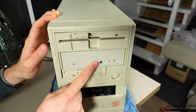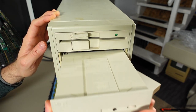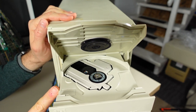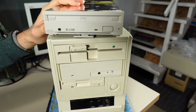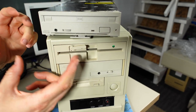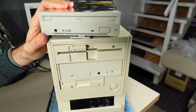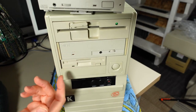If you have a headphone jack connected right there, it's going to come out with the entire unit. The benefit of a mechanism like this meant that you didn't need to use a CD caddy, which was very typical at the time for other CD-ROM drives. Essentially a caddy drive has a slot and you have to take the CD and stick it into a CD caddy and slide that into the mechanism. If you didn't have the caddy handy, you weren't going to be able to use that CD. So this drive gave you an alternative to having to use caddies.